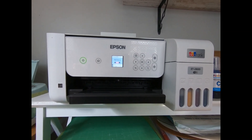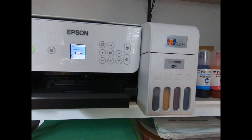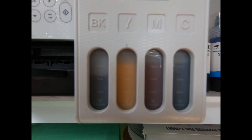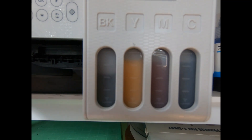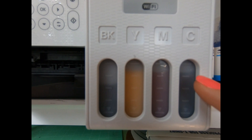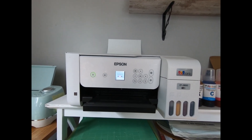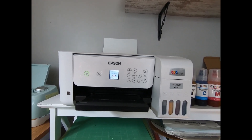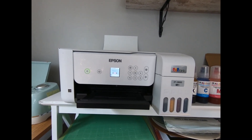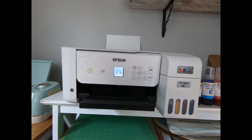So if you're like me and you put in the regular ink that came with the printer, suck it all out first. Then run that power clean cycle — you can see it brought my ink levels down quite a bit, just from running that one cycle. It really dragged them down from the top. So if you need to flush out that other ink, that is definitely the step to take — you don't have to keep printing on paper trying to run it down. I hope you found this helpful. Please hit like and subscribe, and as always, we appreciate you — thanks!